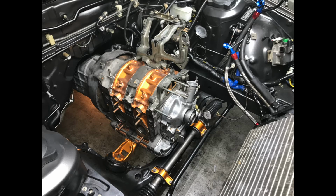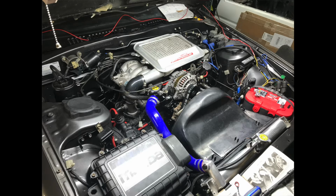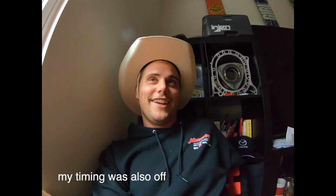What ended up being the reason why the car wouldn't start was that my battery didn't have enough cranking amps. Basically, the battery we were using didn't have enough cranking amps, so we had to use a ton of starter fluid to finally get it started. That's why in the video you'll see it start how it does rather than a relatively easy startup. So yeah.